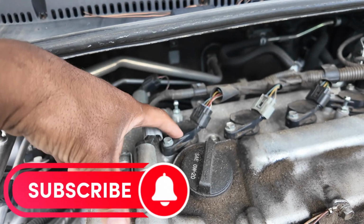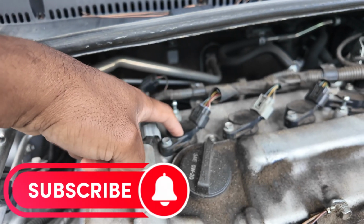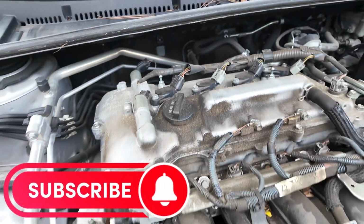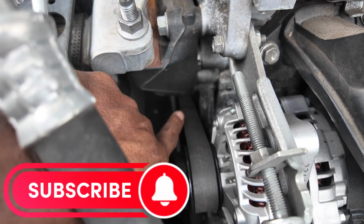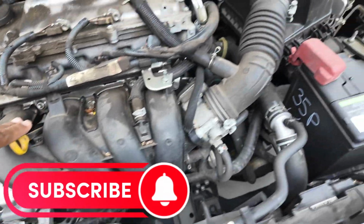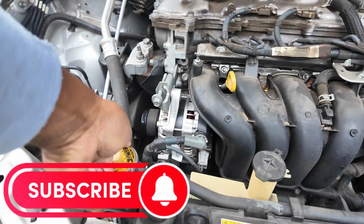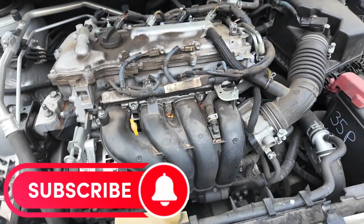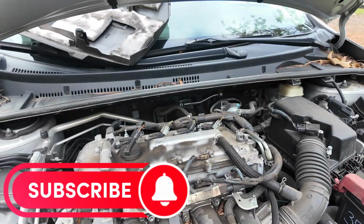So what I'm going to do is put a new spark plug in there, see if that solves the problem. If it doesn't solve the problem, then this coil pack right here is going bad. I'm suspecting the spark plug, however. Also it needs a drive belt, so I'm gonna replace that belt as well. It needs an oil change, and I'm gonna check the air filter. Everything else should be fine. It's got antifreeze, so let me get to it and swap that spark plug and see what's going on.